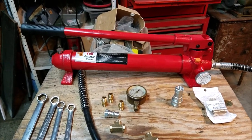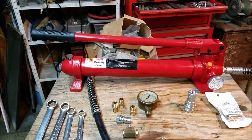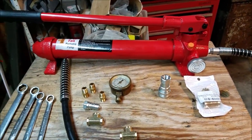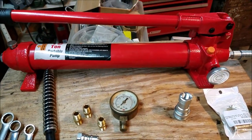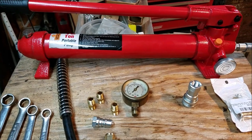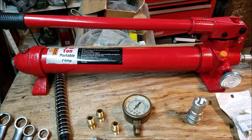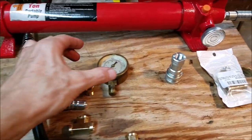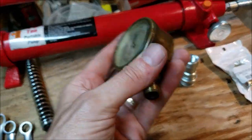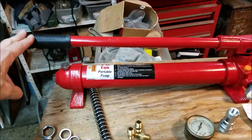Here are my pieces and parts. We need 1,500 psi to override the brake mechanism. With this 10-ton portable pump it gives me 3,000 psi — more than enough. I need to know how much psi I'm putting in. Since I did the Ultra Stop upgrade I have that switch — I could use a volt-ohm meter to note when that switch opens or closes, which tells me I've met my pressure point around 1,200 psi. But I'm going to put a gauge on here. This gauge is all brass, made in America — got it on Amazon for about $42.